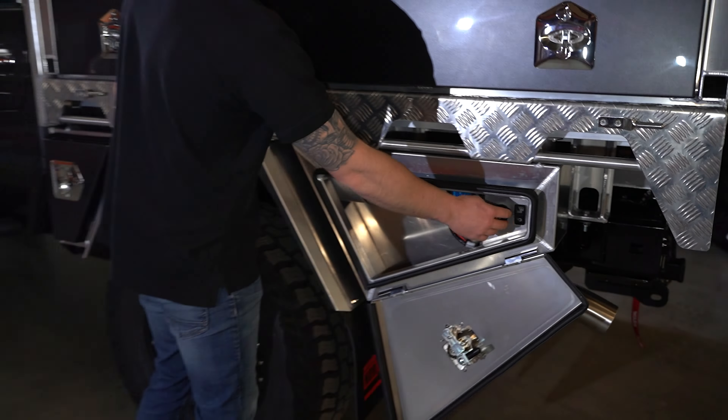Underneath on this vehicle, we've got the JMAX Super Chassis — this is a 4495 package, so we cut off the factory chassis and weld the JMAX chassis into place. This accepts the coil conversion on the rear. It's a much bigger, heavier chassis with an inbuilt rear tow bar and a 300mm extension built in, plus coils in the rear. We've got the track-correcting diff housing underneath, which gives us a higher rear axle load, corrects the wheel track, and also gives us the increased GVM.